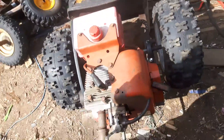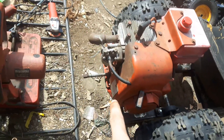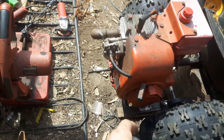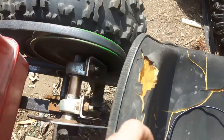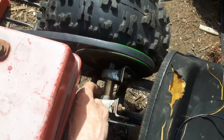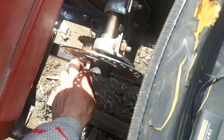Where I'm at now, I need to just make an intake and muffler of sorts. I gotta chop the drain shorter — I'll probably just find a shorter nipple for there. I still need to put my sprocket on here; it's the same width as this bushing. I'll line it up down here and cut a key slot in it.